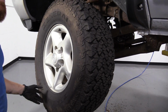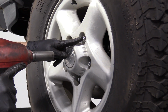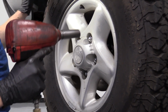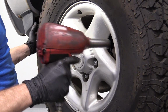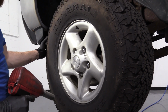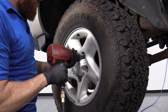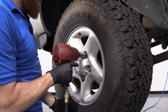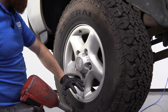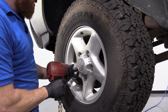We're going to grab our lug nuts, start them on there. So now we're going to take our 19mm socket and we're going to snug up these lug nuts in a star pattern. The reason for going in a star is so that if we tighten it up and it kinks off to the side like this, we might think we have it all fully tightened and we might even torque it down, and the torque wrench says it is. Once you hit a bump, bonk bonk, this thing's free as a goose. So, let's go like this. By going in a star pattern, it starts one side in, you do the other side, it kind of sucks it right down, and then it'll be sitting nice and level for time to torque it down.